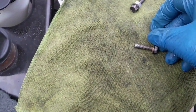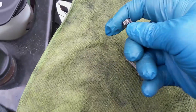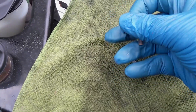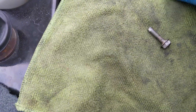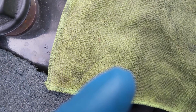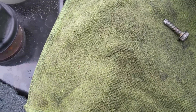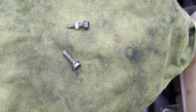I've cleaned the two screws up. These are M6 screws and just to prove the threads are good — I've got an M6 nut that winds on easily all the way out, so the threads are nice and clean and should just go back into the housing. Both threads are squeaky clean and we're ready to put the thermostat in.